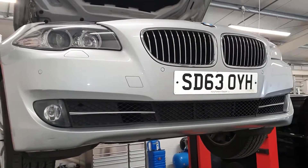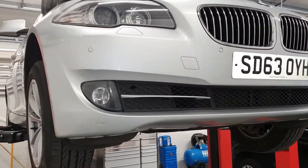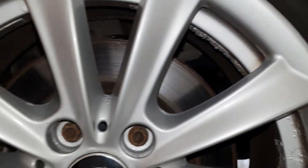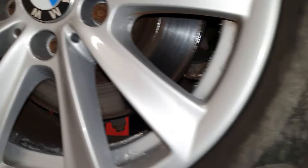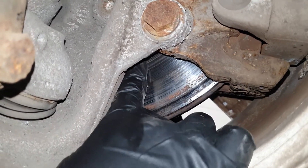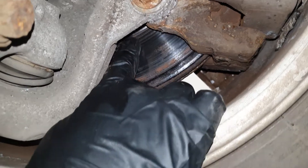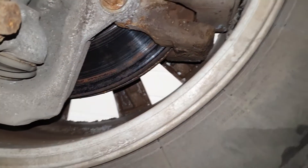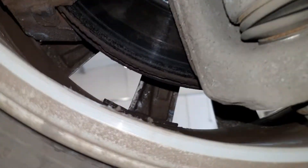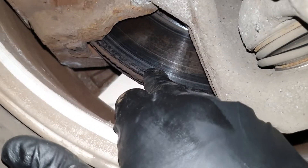There are a couple of things that we'll need to do before we sell the vehicle. Front discs, as you'll see, are alright on the outside — pads have got lots of life left in them. However, we do have some corrosion and some lip in there. There's not a lot of corrosion, it's generally pretty good. Pads are like new, so somebody's put a set of pads in and these have maybe been okay at the time. But I think it may cause a wee bit of a problem in the future.